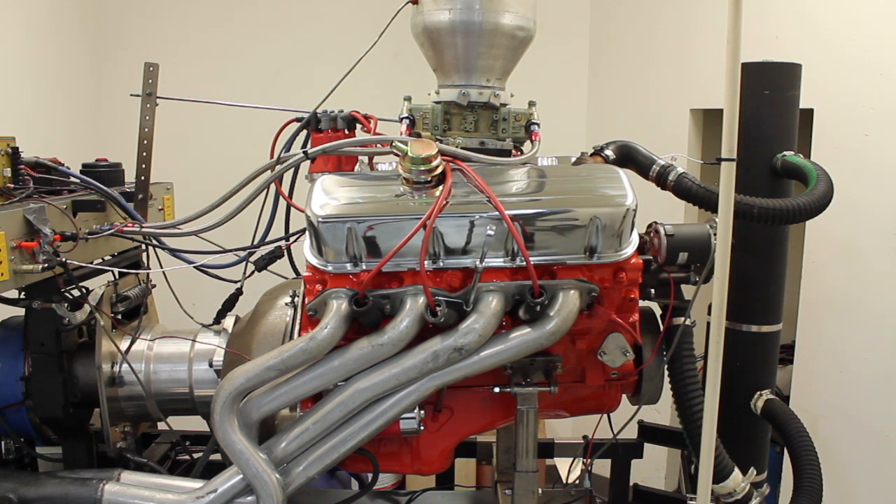On the heads, back in the 70s someone had put an exhaust seat in one of the exhausts, hit water, and just put the seat over. So we ended up having to weld the head. Once we got the head welded, we put all one-piece 1132 knurled bronze guides in the head and honed them to size. We put a 2.250 intake valve. We took a 1.880 exhaust and cut it down from 1.880 to 1.800. We used an ISKY 9315 dual spring with a comp retainer and 10-degree lock. For rocker studs we used an ARP rocker stud and a comp 4806-8 guide plate. The pushrods were Smith Brothers 80-wall chromoly 3/8 pushrods.